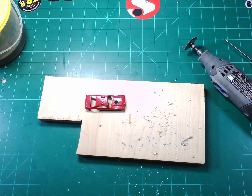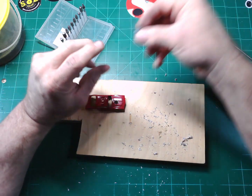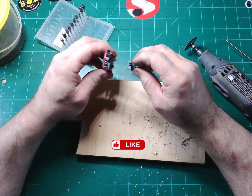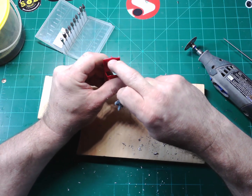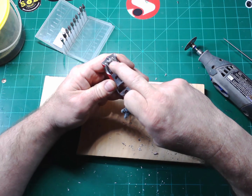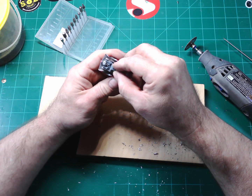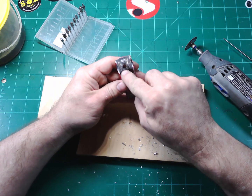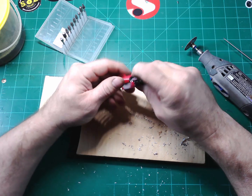So yeah, let's grind this out this time. Because I noticed on that last one when I cut it, the motor that I'm using has a gap right here between the two intakes for the turbos. I need to keep this post here. And I didn't look, but when I was cutting that other one, I was cutting up here because I wanted the extra lip. I need to cut it back here and have that much extra lip so that I can still keep that post. But luckily, the motor will still fit around that post and fit up in there. So yeah, should still work out. Basically, we just need to take off here, here, across the back, and across the front. So yeah, let's see if I can pull this off.